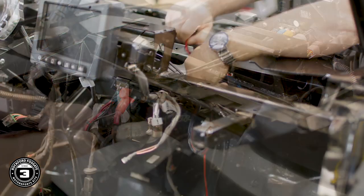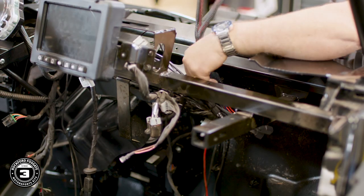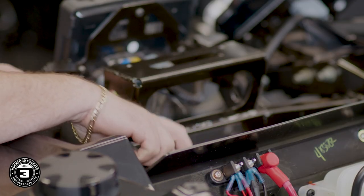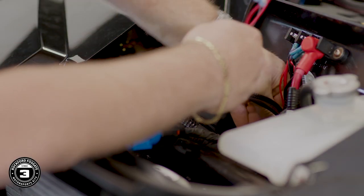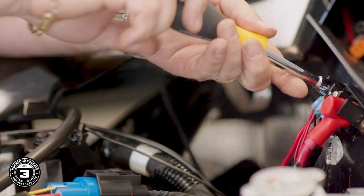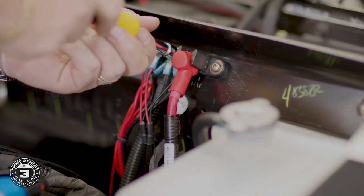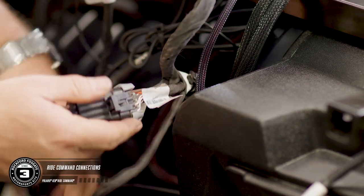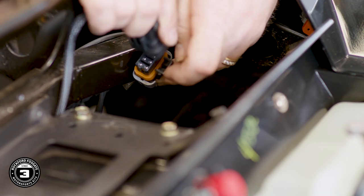With that done, you're ready to feed the wiring back through the factory grommet and into the upper dash area. Be sure to leave enough slack here for any connections that need to be made. This is where you'll run the power line for the Ride Command interface and the Color Optics controller. Feed the cables through the grommet from the inside of the car and up to the distribution block. Using a 3/8-inch nut driver, connect the red wire to the accessory power and the black wire to the ground. Now connect the interface to the Ride Command. You'll find the main cluster holding amp 1 under the dash, and amp 3 is located behind the steering column.